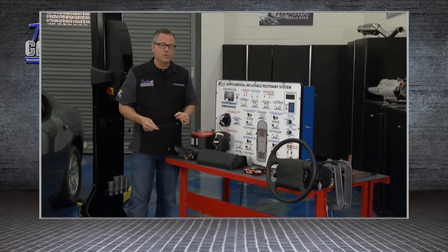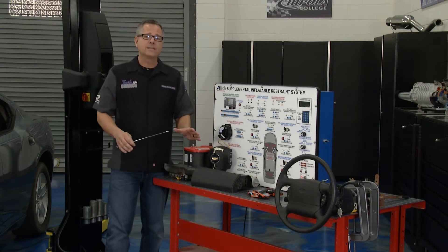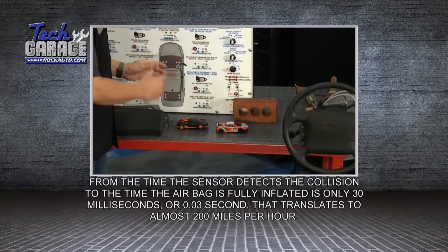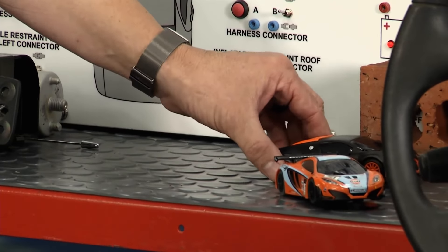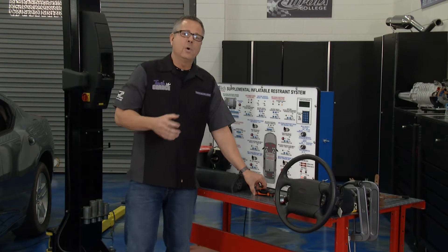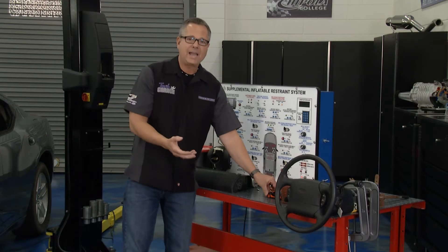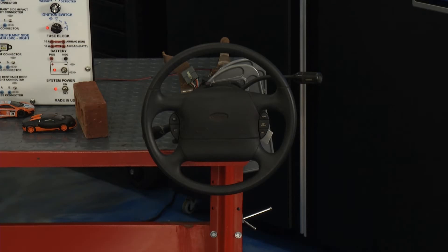It's called delta V — velocity and change in velocity. Delta means change, velocity is velocity, and how fast it happens. You've heard of stage one and stage two airbags — all this is pretty cool. We still have seat belts, occupant seats, weight sensors, all kinds of systems that have to trigger this. You're not just going to go out there and pop an airbag. If I hit a moving McLaren with my Bugatti, it moves away — the delta V is not very high, so maybe the airbags won't even trigger or maybe just the seat belt retractor pulls back. But if I run smack into a fixed wall, the delta V is very high — boom, that airbag kicks out.